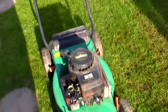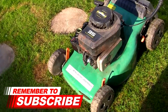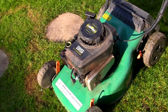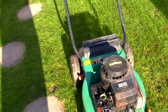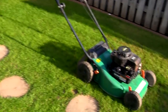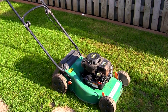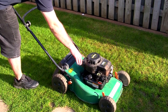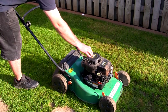You can probably see here I've got quite a bit of white smoke — you might see this and think your lawnmower's kind of had it. But remember I did slightly tip this up and put it against the fence. When you tip it up, oil will transfer down here into this exhaust, and once it's burnt off that'll run okay. So don't think your lawnmower's ruined if you've tipped it up and you get white smoke — that's the reason why. It's running a lot more evenly now — I'm just going to run it until it starts running even and all this actual smoke just burns off. It pulls over nice as well — it's not kicking back when I pull it over, so I know there's no problem with this keyway.